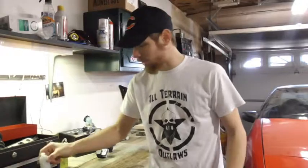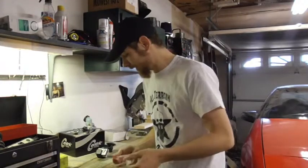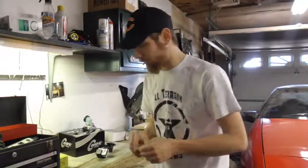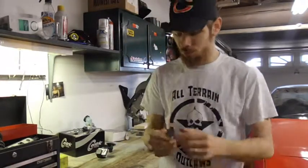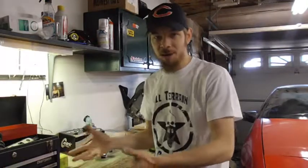Instead of this tiny little bottle, we should have grabbed a regular water bottle, put a hole through the cap, and run the tube straight down to the bottom of the bottle — and make sure the tube end is big enough to go over the bleeder screw, which eliminates the adapter piece as well. The kit did have a magnet which just kind of went into the back of the cap — not that fancy. You could get little magnets from the store, or just use a couple zip ties to secure the water bottle. Seriously, it wasn't really worth buying the kit.